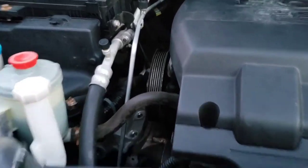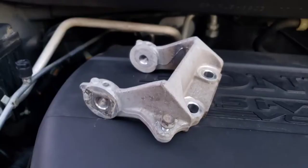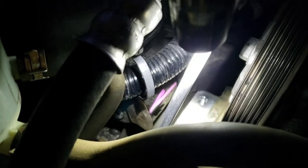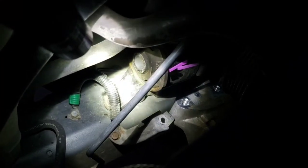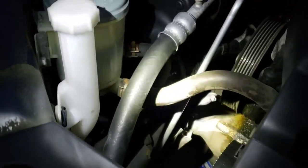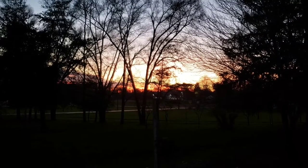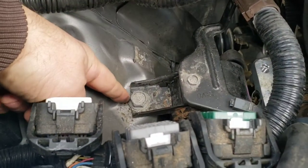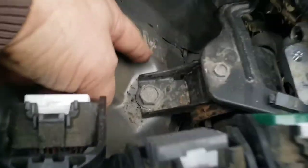You take the long bolt out, take the top two bolts off. On this Odyssey there are three bolts holding the rest of the motor mount, and there's one that's recessed in the middle — you cannot get a ratchet or a regular box end wrench on it because it's recessed in the mount. So I have to unbolt the other piece of this mount from the frame to give myself clearance.